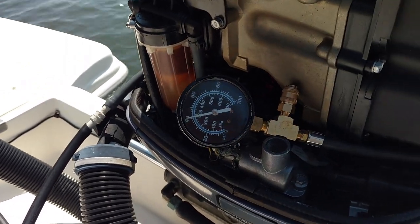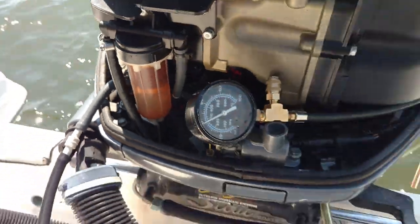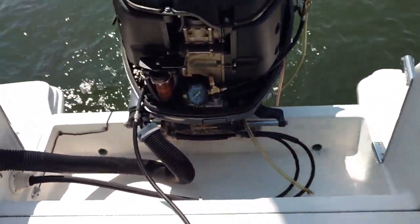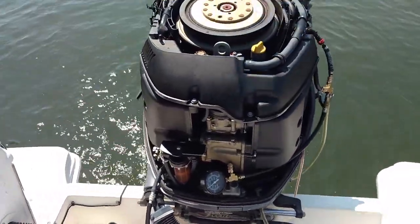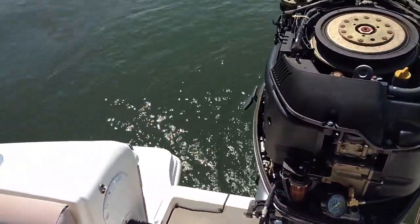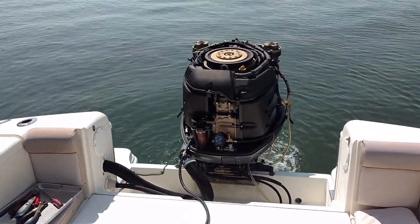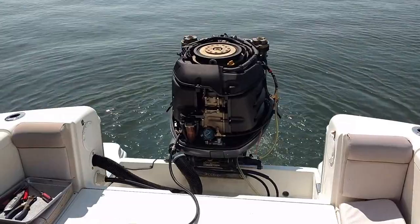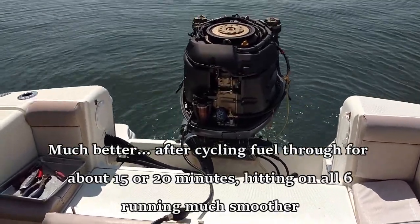Holding fuel pressure steady — that's about where Yamaha likes to see it. About 40 PSI, sometimes they go down a little bit lower, maybe 38-ish. We're just running off shop fuel here. All I'm doing is pumping fresh fuel into the VST and letting the VST do its job, which is push fuel throughout the rest of the injection system and get it to all the injectors on both rails. Hopefully we'll replace some of the water that's in the injectors. Probably won't get it all out, but the objective is to get as much water out as we can and get this boat to the hill. Sounds like all six are back online now — might still be missing on one, tough to tell sitting here in the water.